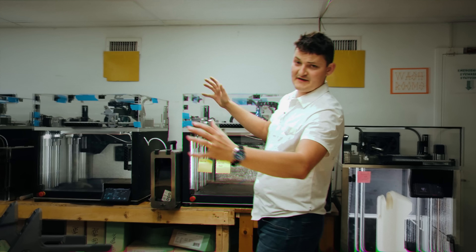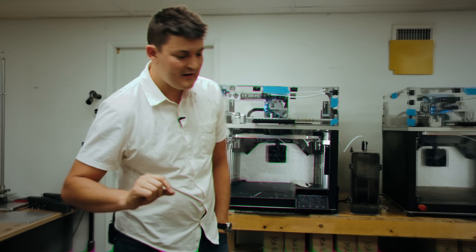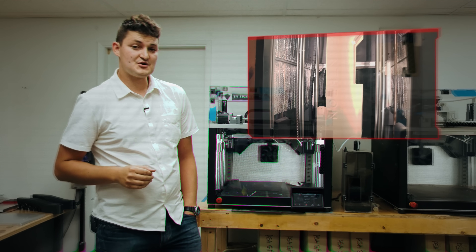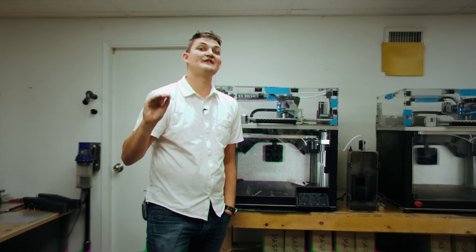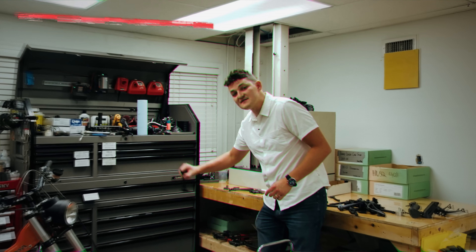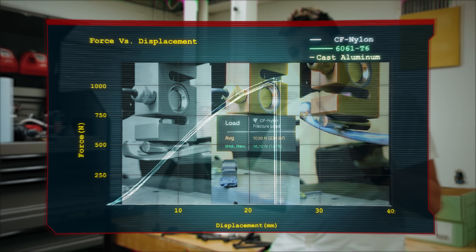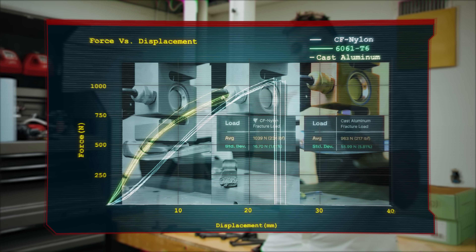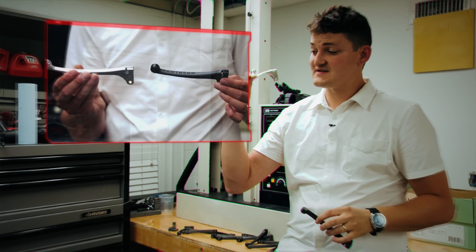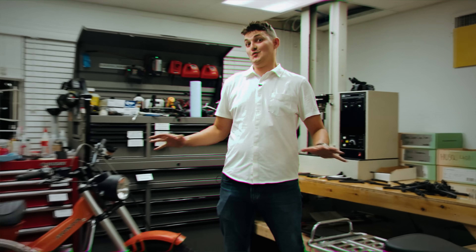But these are not your cosplaying grandmother's 3D printers. These are Pantheon HS Pros — each one costing more than a Ducati — and each containing a proprietarily precise strain gauge in the nozzle. That lets Pantheon inject more and more filament right up to the point of over-extrusion, flying micrometrically close to the sun without melting into a mess. Pantheon's polyamide carbon fiber comes within 15% of the strength of injection-molded solid material, which has more repeatable strength than die-cast aluminum and a slightly higher maximum load than CNC 6061 T6. The printed lever is 34 grams to Honda's 59, and dimensionally accurate to ±50 micrometers versus Honda's ±100. Additive manufacturing is safely feasible for motorcycle parts.